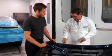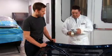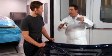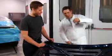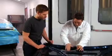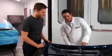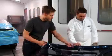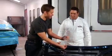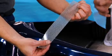Like so. All right. Then I'm going to use, this isn't your normal masking tape, it's a little stronger. This is a packing tape. Okay. And what I do is I place that over the area. Just press it down nice, like that. And I want you to just yank it off. Just yank it? Yes. All right, here we go. Well, I don't see anything on that tape. Exactly. There's no adhesion failure.